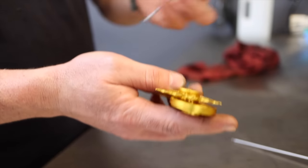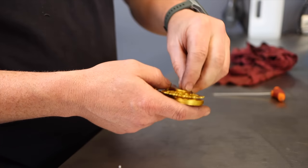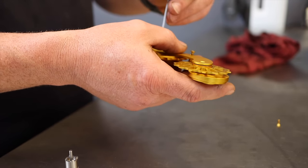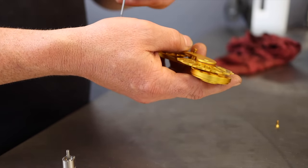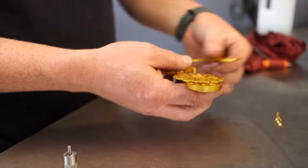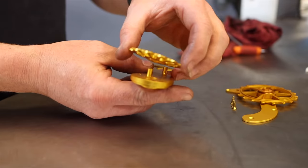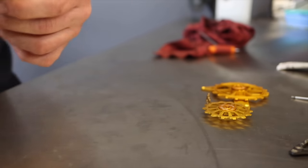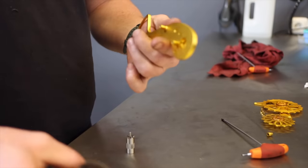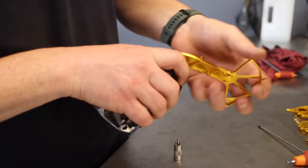Next, install the new derailleur cage. It is easier if you disassemble the new derailleur cage first — remove the pulley wheels and the little screws. Make sure you put the screws and components in the right order so you know how to remount them, and make sure not to lose the screws. Now attach the new derailleur cage, making sure you align it with the spring of the derailleur.